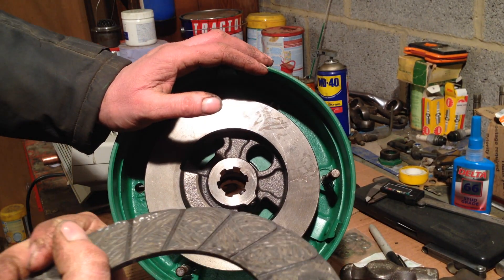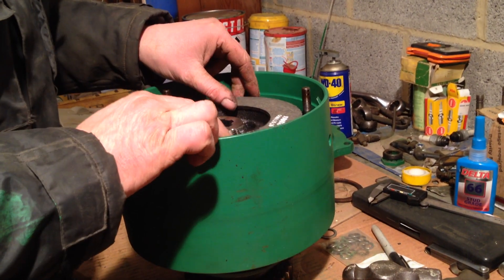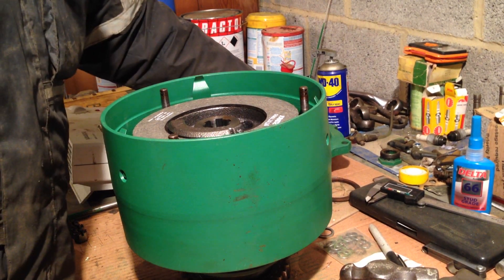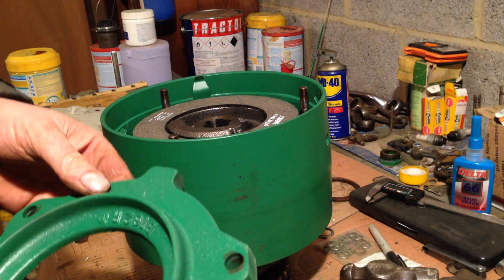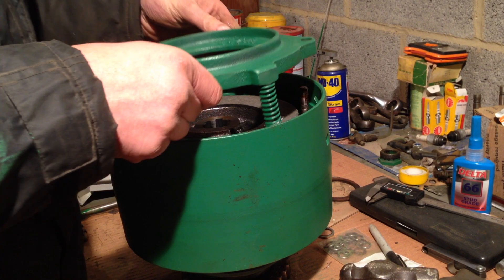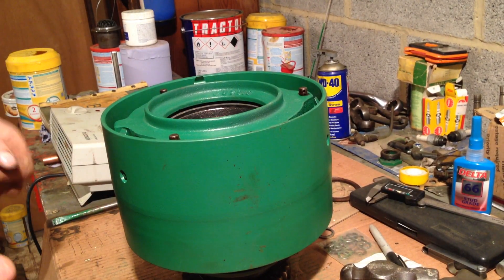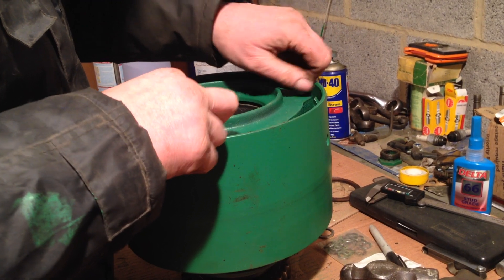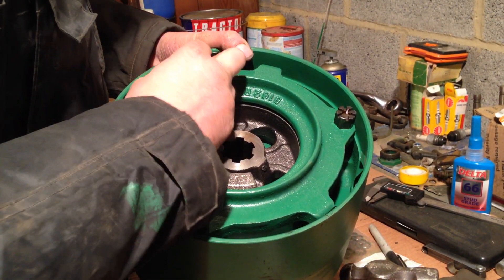Get your other lining facing and put that on there. Then you've got this part here, which is the other half of the actual clutch mechanism. You sit that in there so the three T-bolts come through these holes here, those springs sit against the face, and the driver. I'm building this up roughly here because this has to actually be built up on the tractor - I just thought it might show better how it all works.